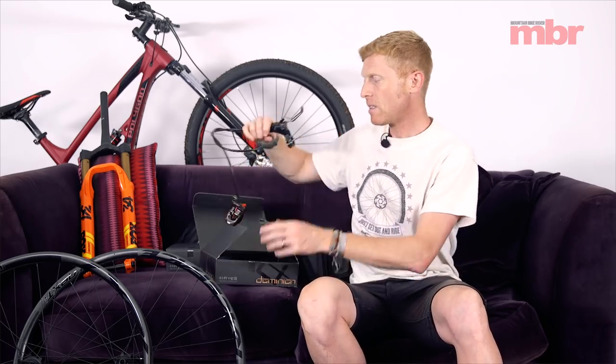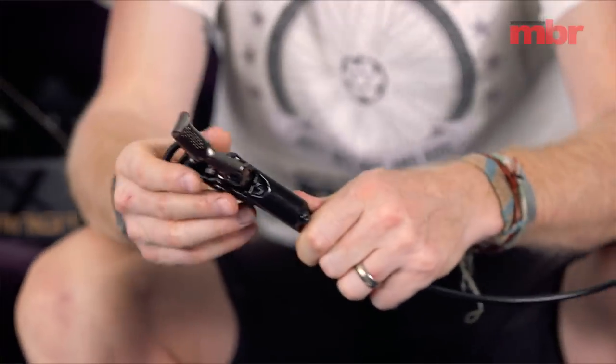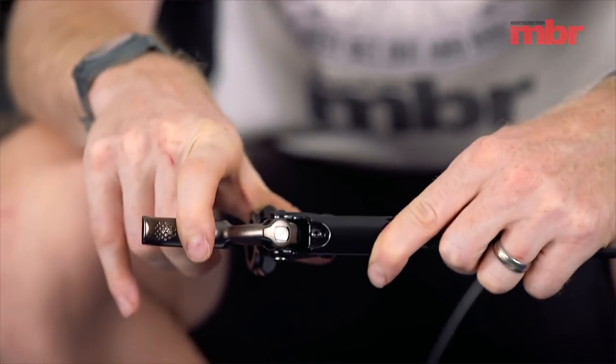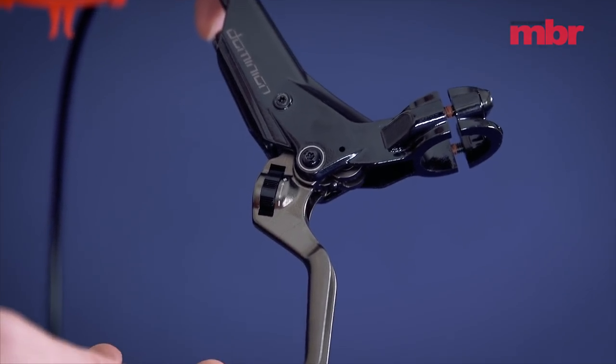Let's have a look at it — I opened this one up earlier. This is the front brake and there are a few key features. It's been completely redesigned — it's not like any other Hayes brake that's come before it. Starting with the lever: it's been designed around something called LoFi technology, which translates to a very light action at the lever but producing a very high output force at the caliper. To do this they've redesigned the lever pull and the master cylinder, which slides on guide rings — low-friction plastic inserts that allow it to move very smoothly, reducing the force needed to pull the brake.